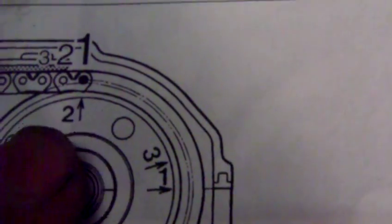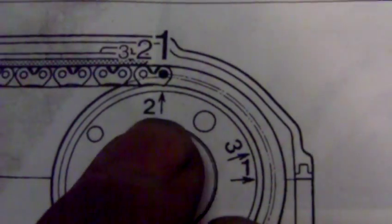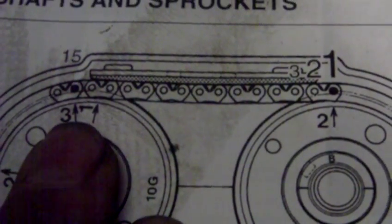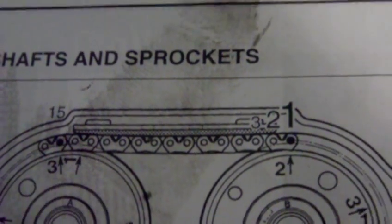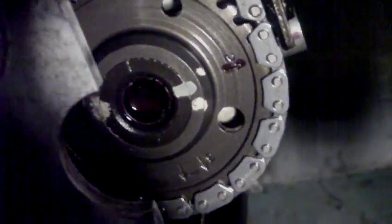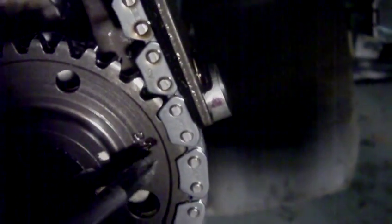What they're saying is this here — so you count the pins up to 3, which should count to 15. Now, before I took my old chain apart, I put some black marks here and then on the post here. When I put the new chain on and marked it up as Suzuki said, with 15 pins up here, I put it back together.